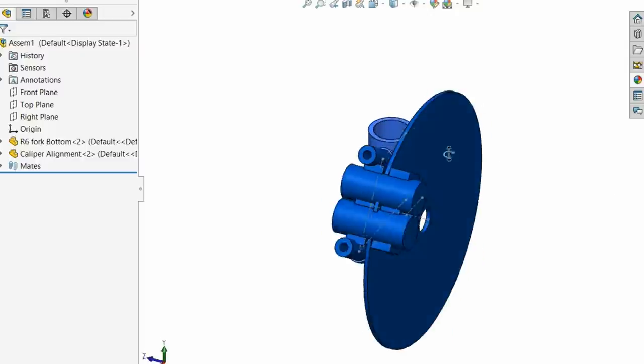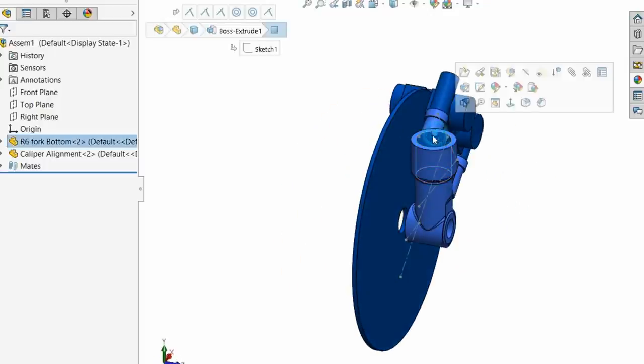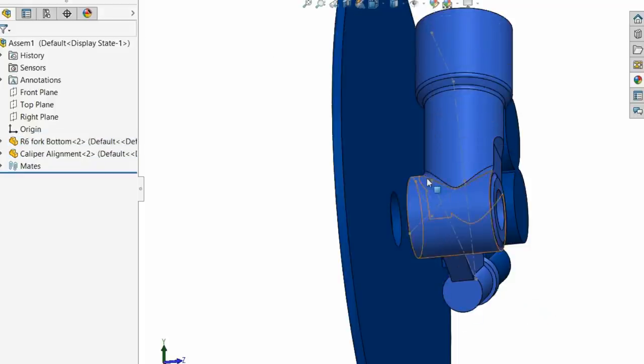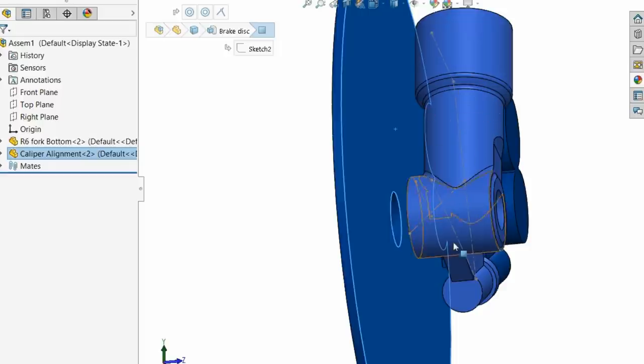You can then start to say, well, what do I need? I need to make sure that this bottom is 4mm further in or 6mm further out, kind of thing. And then I'll make sure that the wheel spacer that I need is from this disc surface. So basically you'll measure from this disc surface on the XJ where the shock body is and what the clearance is between the two, that kind of thing.